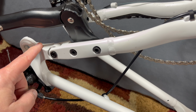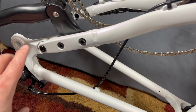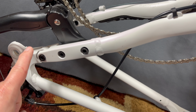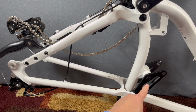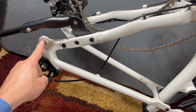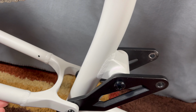2.08333. We can actually drop the threes because in 100 millimeters of travel, they are inconsequential. So 1 to 2.08 millimeters of travel is the difference between the front and the rear. 1 millimeter of travel at the front gets 2.08 millimeters of travel at the rear. That is max travel here.